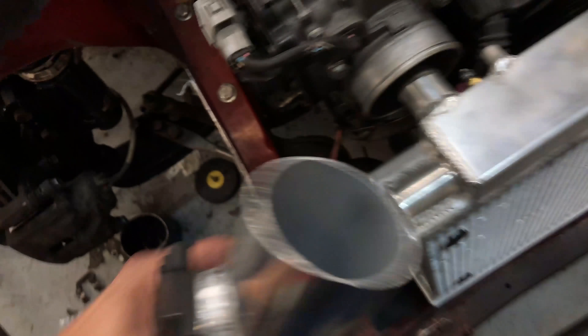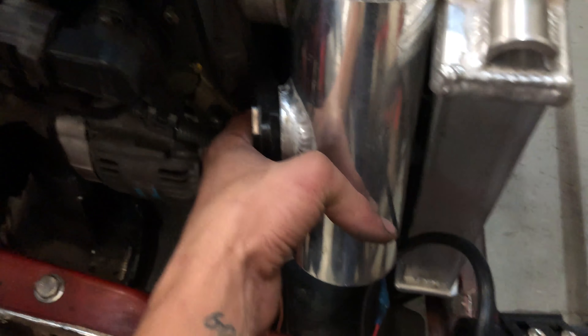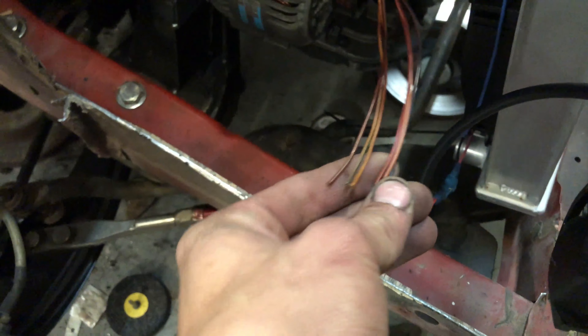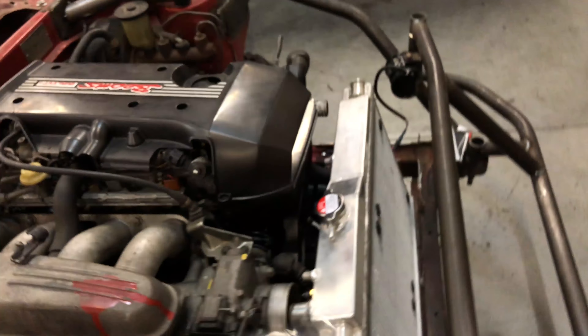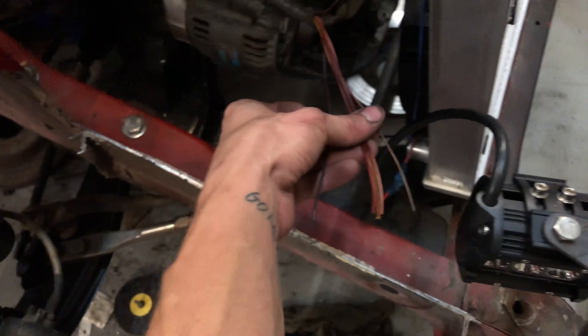Here's the MAF tube — pretty simple. It's basically going to sit like that, but there's a stupid radiator in the way. Without the radiator there, the little air filter down there will work fine. I'm currently trying to find which wire is which for the MAF because I ordered the MAF plug with the pins. Since this came pre-cut I have no idea what's what, so I'm hitting up some AE86 or BEAMS people to see if anybody can send me a picture.